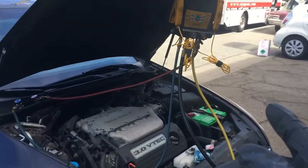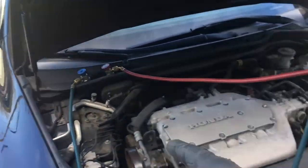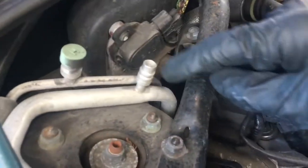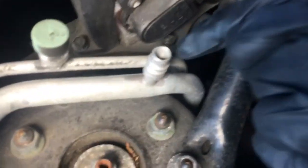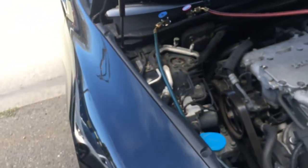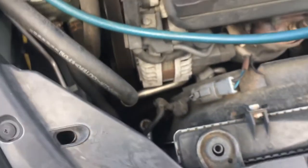We have this 2007 air conditioning complaint and I'm just starting to look at it — I have not gauged up yet. What do I notice? The missing cap. Has somebody tampered with it? Probably not in a long time, because looking at it really closely there is no oil or dust buildup around here. Looking deep inside the threads, there's no dye, no oil, no dust — this thing is bone dry. That tells me it wasn't touched just prior to me getting it. Customer complaint: doesn't work. Follow all your lines, look for leaks — you do your visual first, you confirm what the customer says.